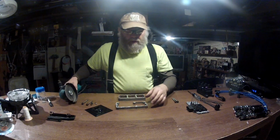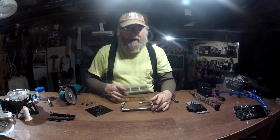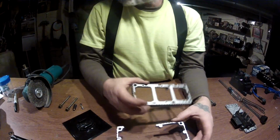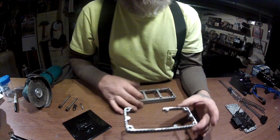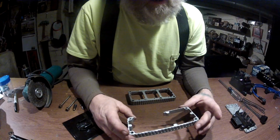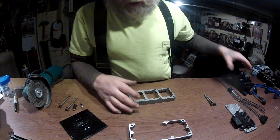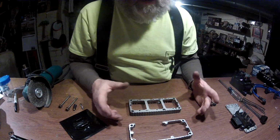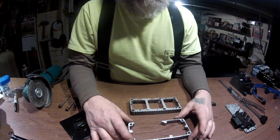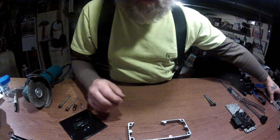Okay, what I did now was I cut down my heat sink. As you can see, I cut it down to 9/16. The instructions I read on the internet said that you were supposed to cut this down to 9/16 because of the difference in the height and the coils mounted on the heat sink. They said that cutting the heat sink down is not a real big problem because people have used this for 100,000 miles and not had a problem.